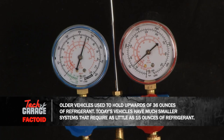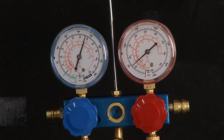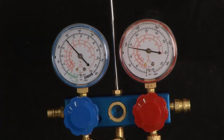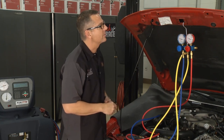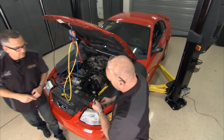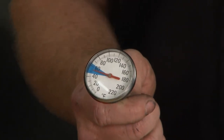Give it a shot, Brian. Now it's going to sense the pressure — the compressor should kick on. Once that compressor kicks on, we should be in good shape. And there goes the compressor — high side's climbing, low side's dropping. I can tell by looking at these gauges it's got to feel pretty cool in there. Yeah, it's great — I've got a duct temperature right between 40 and 45 degrees, right where we want to be in the blue. We are definitely circulating the proper refrigerant, and it feels great in the cabin. This one's in good shape.